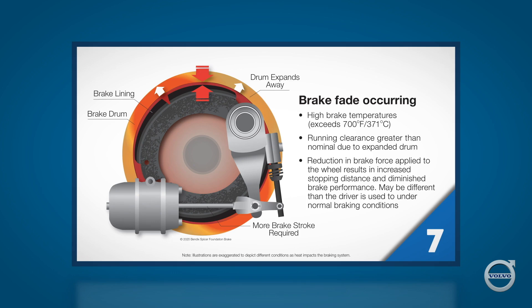Dangerously overheated brakes can reach temperatures of 1,800 degrees Fahrenheit or about 1,000 degrees Celsius or even higher. These will glow cherry to bright red, and there's a serious risk of a wheel end or a tire fire — that's if the truck manages to stop before it crashes.